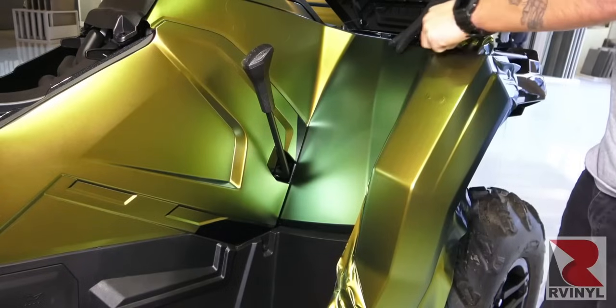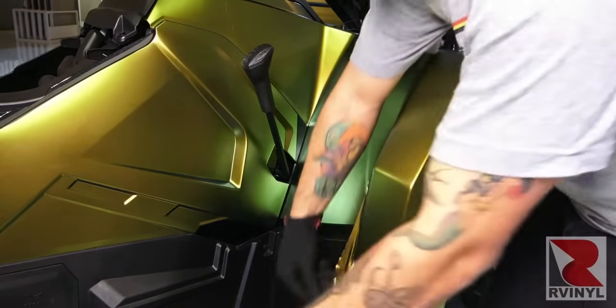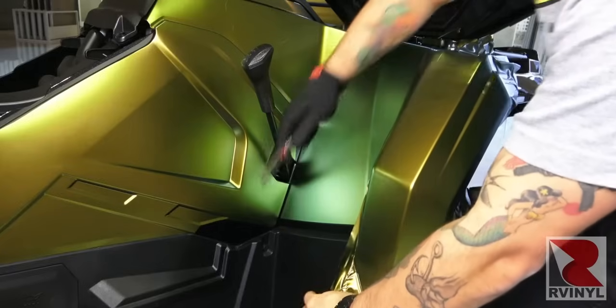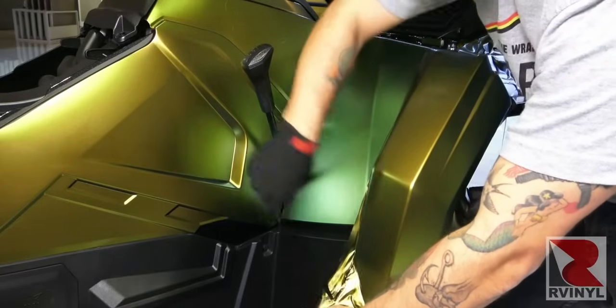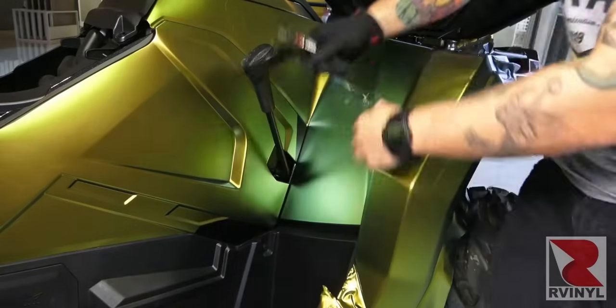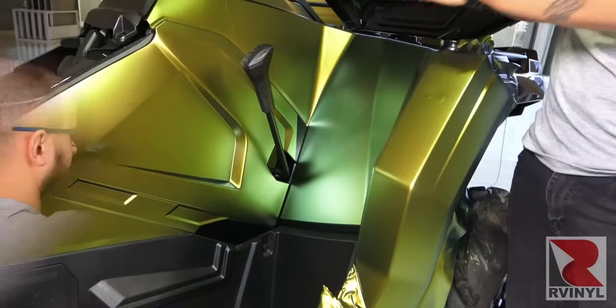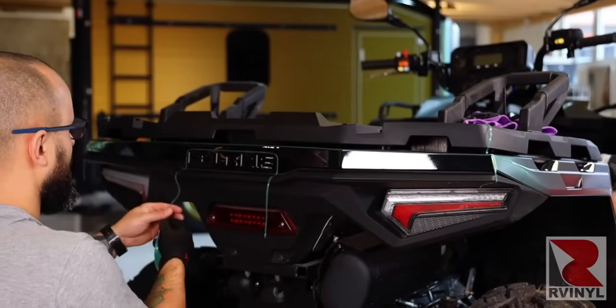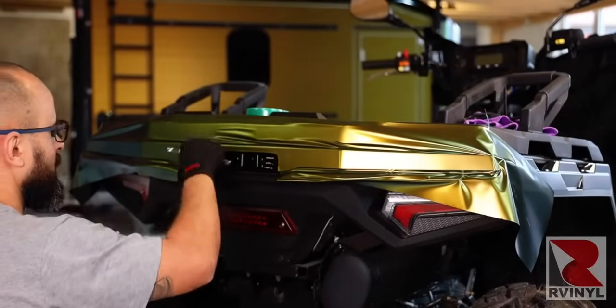And once the material is on the main area, the knifeless tape is released, again pulled perpendicular, and here there's an overlap on the body line, roughly 1/8 of an inch wide. This is for long-term hold, plus the edge faces in towards the body of the vehicle, so it makes it look more seamless. So here in the back section, there's a very complicated deep recessed area where the letters are,